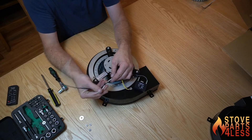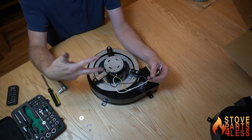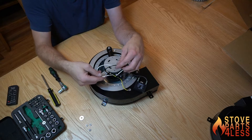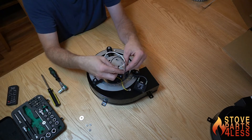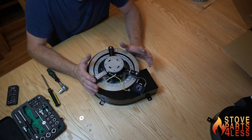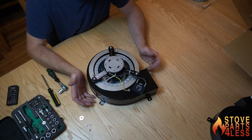This one is going to have just a white and a black. Now these wires are going to have to be fished up through the stove if you want to go that way, and it's very difficult. So if you cut the other wires, you're going to take some quarter-inch spade disconnects — females on one side, males on the other — and connect them to the wires at the bottom of the stove. If you have an older stove with the blue and red wires, know that the blue and white wires don't go to anything. You can cut those at the bottom of your stove and just leave them alone — tuck them back up or tape them off so they're not in the way, but you're not going to use them.